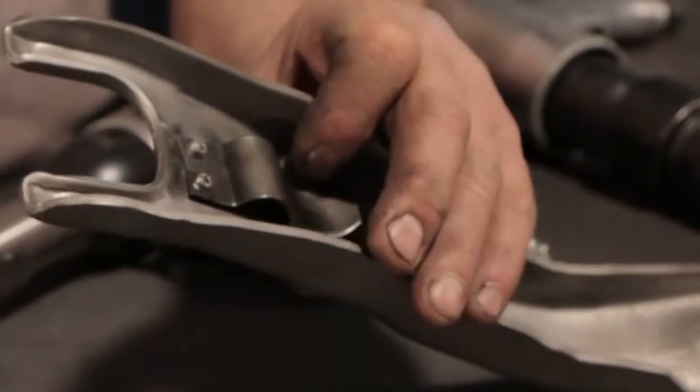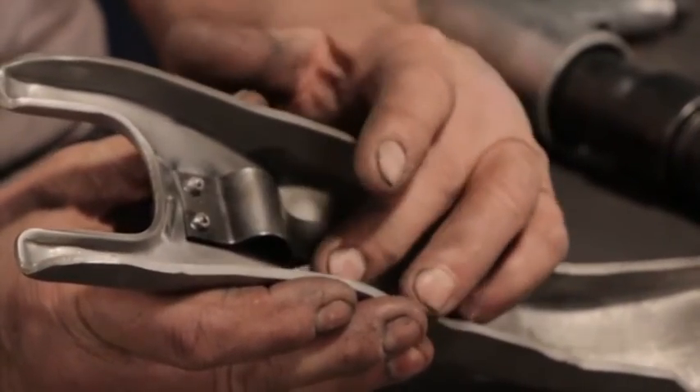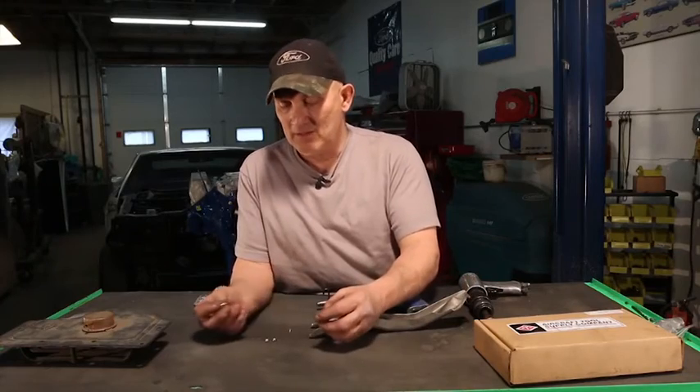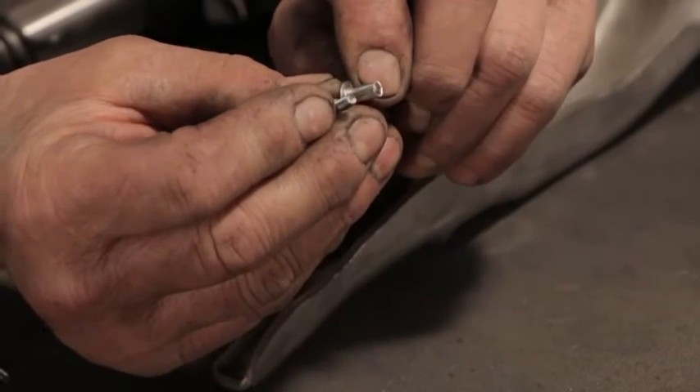This clip was broken on the back here — that's the reason we're doing this. The clip was broken in half and the fork was flopping around inside the bell housing. They give you these little tiny nylon locking nuts, and you can tell the difference in diameter. You don't want to use those in your car — those are junk.